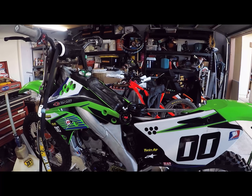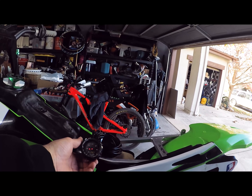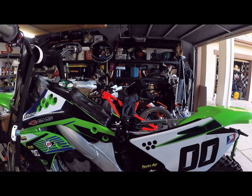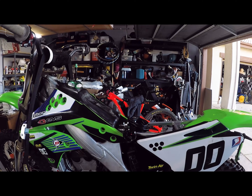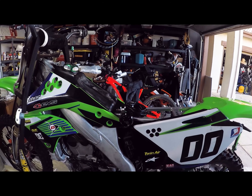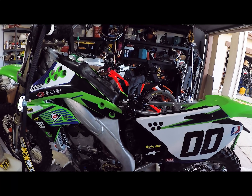Sorry about that — it's kind of hard to film this with the chest GoPro mount. So basically as you saw, my other issue is that my air fuel screw is not tight in there, so as the bike vibrates it actually goes leaner. I have to readjust it, but every time I put it back to where I had it before we're right around that 13.3 range, which is where I want it at idle. But as you can see, when we give it gas in the quarter to half throttle range, we are getting really lean. To me that's an issue with our needle clip position, possibly the main jet, but we'll look into that.